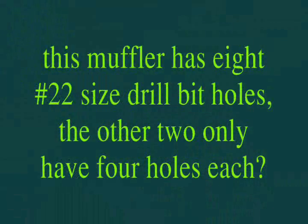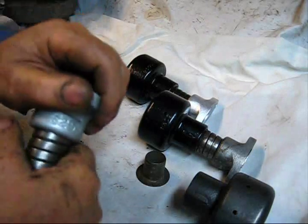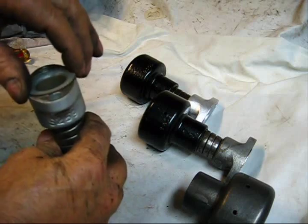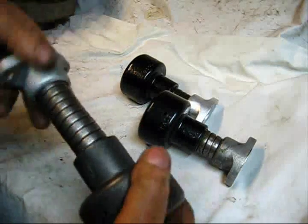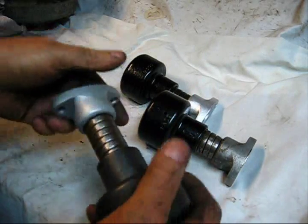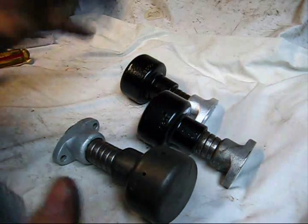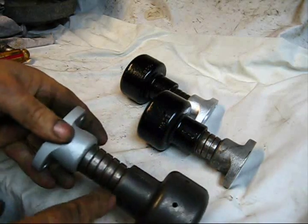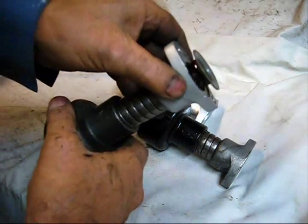You don't want any leaks. Screw this one up in here. Before you start tightening it up, put the insert in there. I can see that shellac ooze out in yonder, so that looks like plenty. Put that right down in there. You put that right up on there. Some of them will be tight, some won't. When you screw this together, what actually happens is that pipe expands — you can make the pipe bigger or smaller by a small amount. Twist that together really good. You actually want the exhaust pipe to bottom out on the bottom of the muffler and at the top of this thing up here, which I can see it in there.